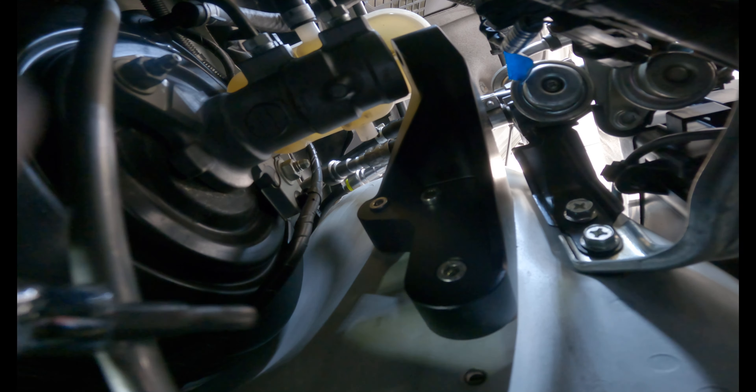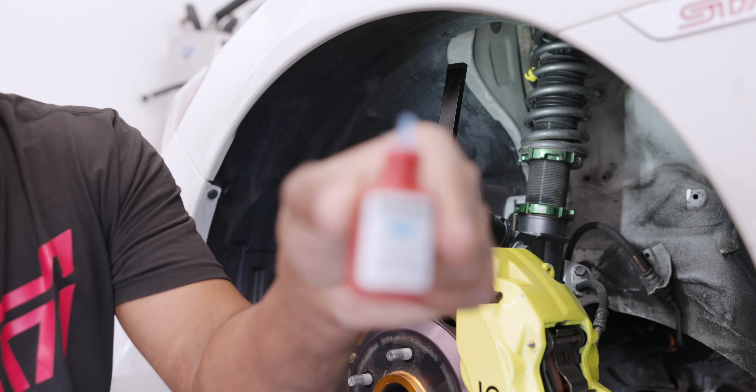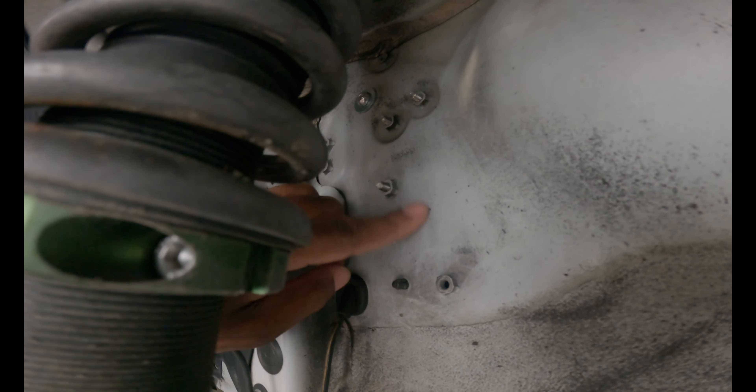The reason I had to stop and take the tire off and do it right was because if you look right here, it looks like it was going a little bit cross-threaded. So we're going to take that off and do it correctly. We're going to put a little bit of Loctite blue on these threads that are sticking out, that way they don't vibrate loose.